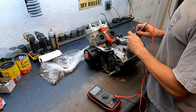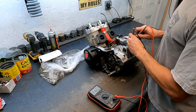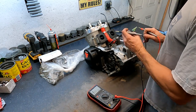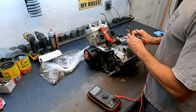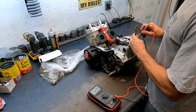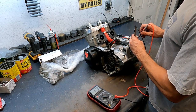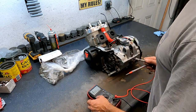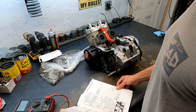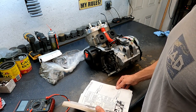That's the pickup that rides on the outside of the flywheel, or magneto as the service manual says. It looks like it is 112, which I believe falls within the good working resistance. The coils, which are the stator coil windings, came in at 17.3 — the green to the red, which is the coil windings, spec is 13.7 to 20.5, so we're right in the good range.